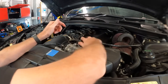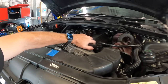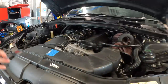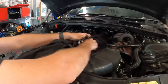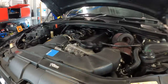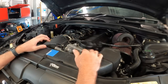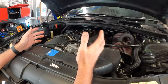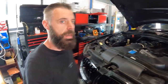I am going over the top with oil changes on this, I feel. I think this oil's probably done — I changed it when I did the DCT, so it's probably done about 1,500 Ks, which is not many. But I feel like at this sort of power level with hybrids — little China frame hybrids — we're probably pushing things a little bit too much. I can imagine cylinder temps in the engine are getting high. The exhaust housings on these China turbos are pretty much the same as a stock turbo, and it's not great for this power. But we've got to do what we can to make it last, so we'll keep the oil fresh as often as we can.